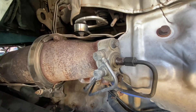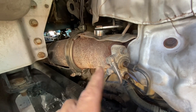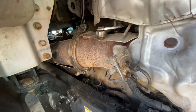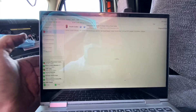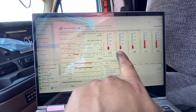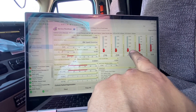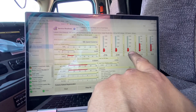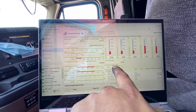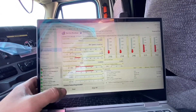I replaced it with another one I have here. Hopefully that's going to work. At the same time, we went ahead and cleaned out any carbon in the back. My guess was this was getting stuck open — I'll confirm that right now. Hopefully that was the problem and we don't have to dig any deeper. So we fired up the truck, and what you're going to want to do — you need your software — you're going to need to do a parked regen. That way you can check your temperatures: DOC in, DOC out, DPF out. This was the one giving us the reading of 1,200 degrees. By default it will actually turn itself off and shut down as a protection so you're not going to melt the box or cause any damage. The other thing you're going to look at is your fuel doser percentage and PSI.